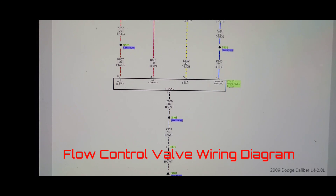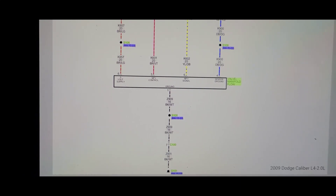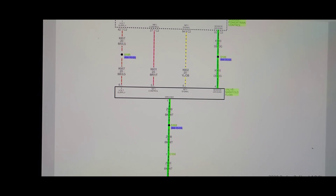The manifold flow control valve is an actuator controlled by the PCM, and it has a position sensor that reports the position of the valve to the PCM as feedback. Looking at the wiring diagram: terminal one is a constant ground, terminal four is a ground supplied by the PCM, and terminal six receives a five volt reference from the PCM — constant whenever the engine is running. The PCM controls the actuator in a duty cycle mode, moving the valve to increase or decrease its opening. Terminal five carries the signal from the sensor reporting valve position back to the PCM.